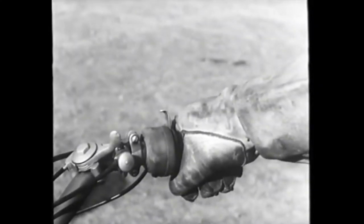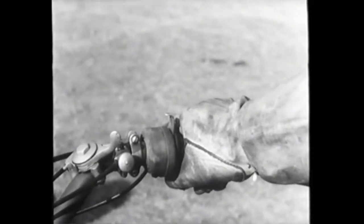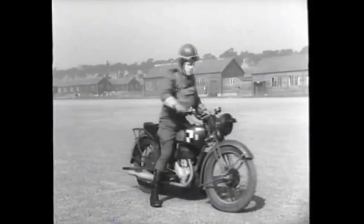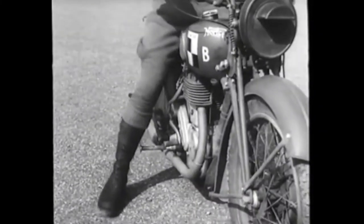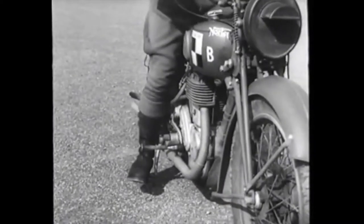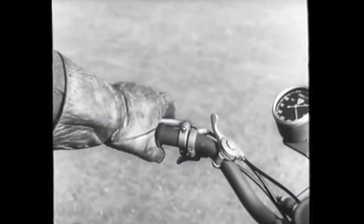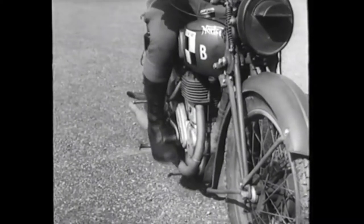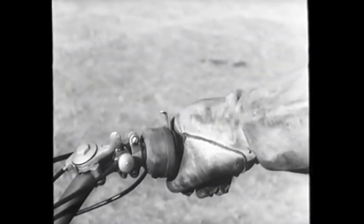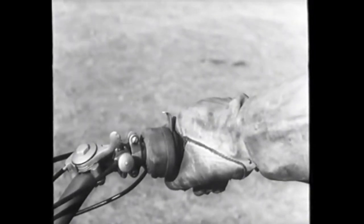Now increase the engine speed slightly by opening the throttle. Then let in your clutch, but not suddenly like that. Now, while the rider is restarting, here is a guiding principle for moving off smoothly. As you gradually let in your clutch, gently open your throttle at the same time, and that's what the instructor